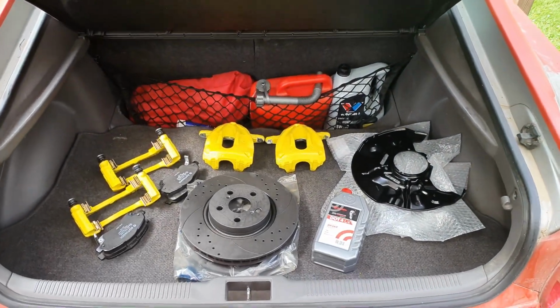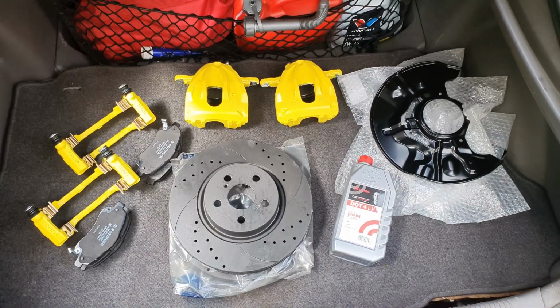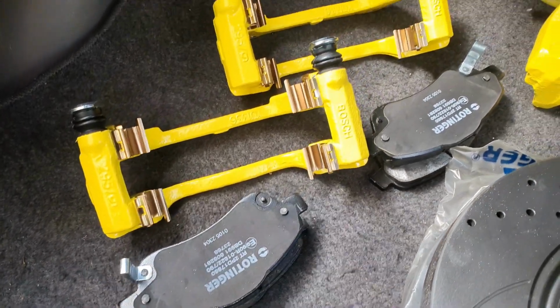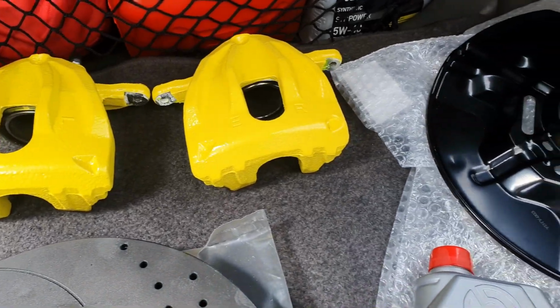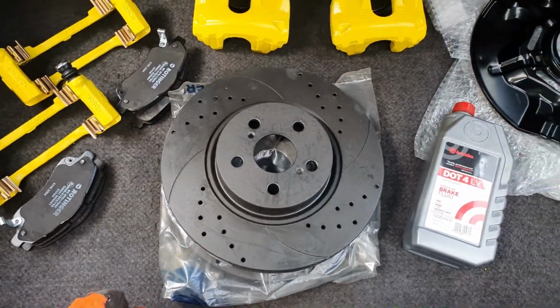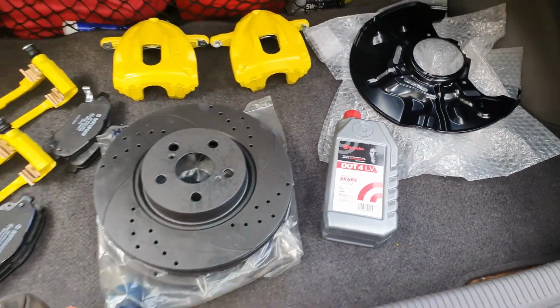So, what we are going to need for this project is... For this project we actually don't need anything special apart from the standard brake parts. So I've got Avensis caliper holders with new slider pins and brake bed plates, the Avensis calipers, dust shields, these beautiful 295mm Rotinger drilled and grooved discs, Rotinger brake pads, and some DOT 4 brake fluid. I will put a list of all part numbers in the description so you can find them easily.